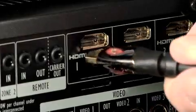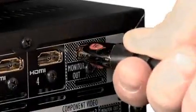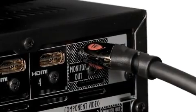So you just purchased your brand new Harman Kardon AVR and paired it up with a great Blu-ray player, the BDP1. The first cable you're going to need for your Blu-ray player is an HDMI cable. You'll also need an HDMI cable to go from the receiver out to your television set. Once connected, the Blu-ray player will send digital video and digital audio through the AVR. The video will get sent to the TV, while the receiver processes the multi-channel audio soundtrack available on the disc.